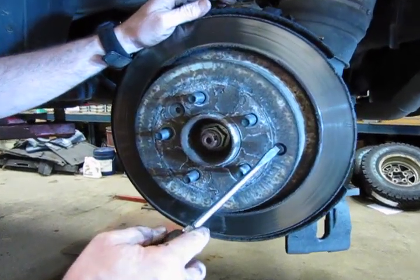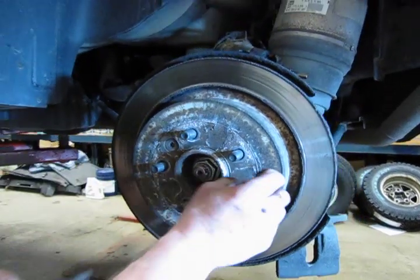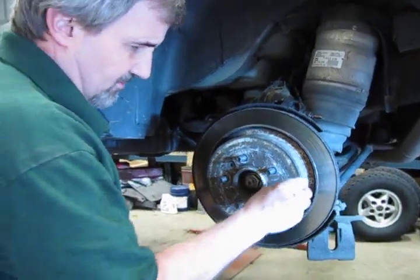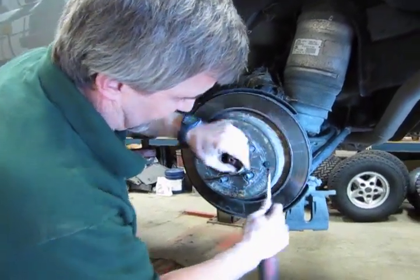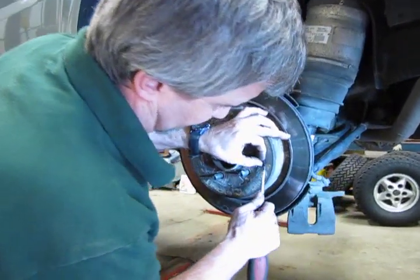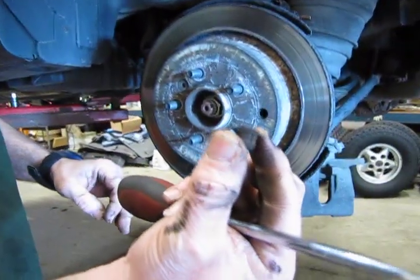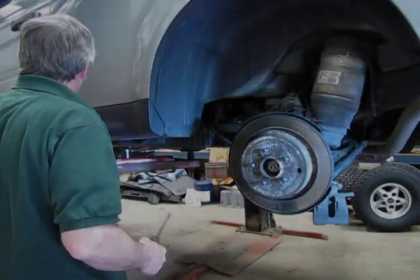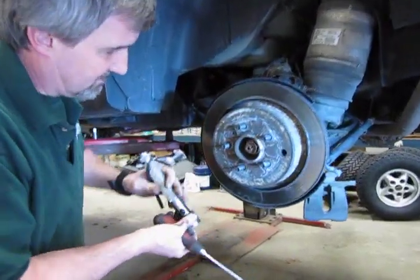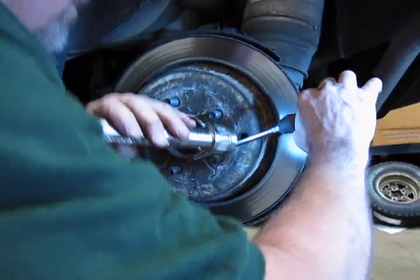If you see that, more than likely you're probably going to be replacing those brake shoes inside, and you'll see those in just a few minutes. But we're going to pull that right out. It's got a little cap on it so you can either get a bite on it with a pair of diagonal pliers or a small knife, but that's essentially the cap. We're going to put that aside. And with a flashlight, you're going to spin this rotor until you can see.